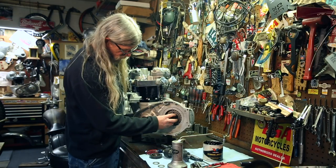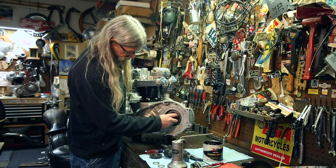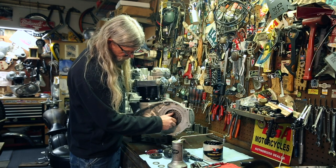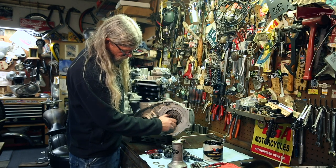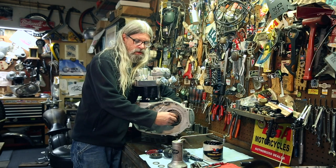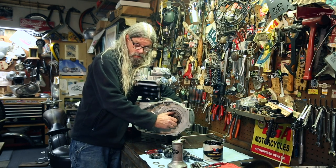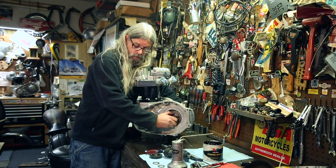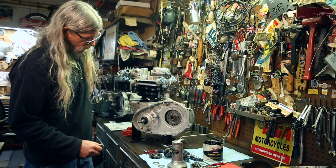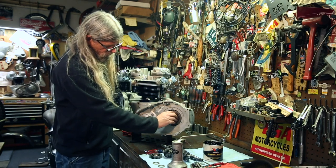Okay, then we'll go ahead and get our nut on there. Should go on nice and easy. Shouldn't be any forcing that. No forcing of nuts. If it's not threading on easily, the threads are boogered. Stop. Take it apart. Look at it. Figure out why. Okay? Now, bet you're wondering how in good God's name we're gonna torque that darn nut.